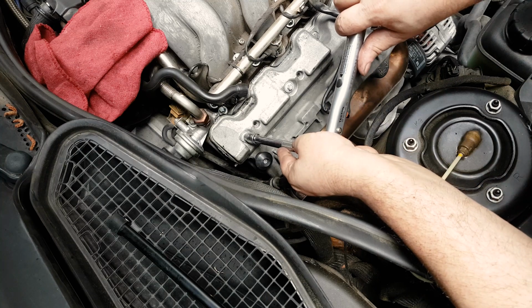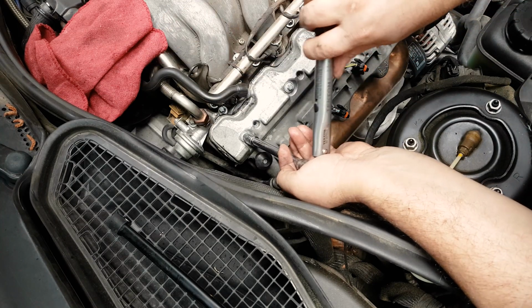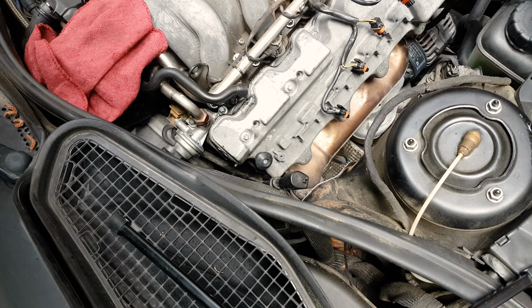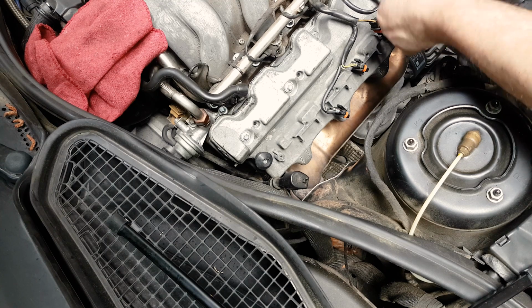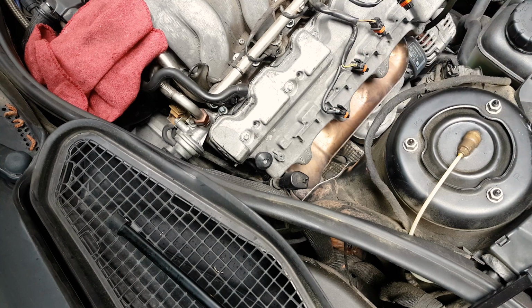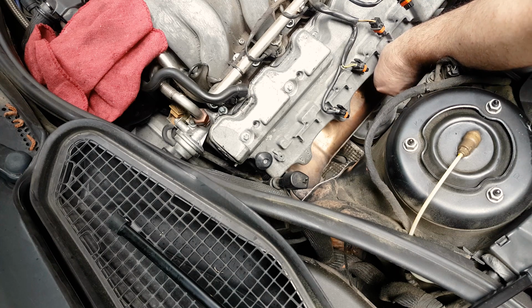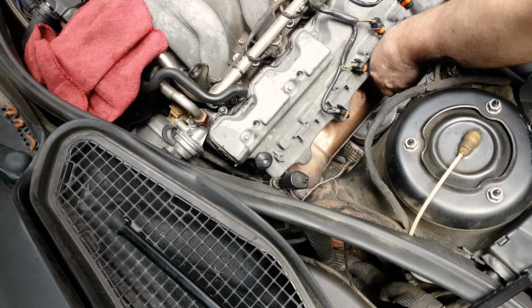So you want to torque these two bolts first, and on the driver's side, of course, the 3 bolts, and then go all around the valve cover and torque those. You can go from the center out, or whatever, as long as you torque all of them to the same value of 9 Newton meters, then really it doesn't matter. But what's important is the crankcase cover. You want to torque those bolts first, so that the liquid gasket sits, and that you don't disturb it afterwards.